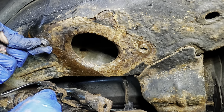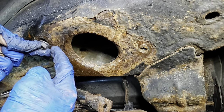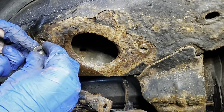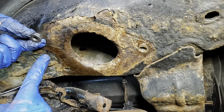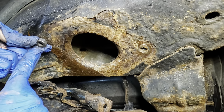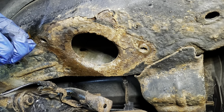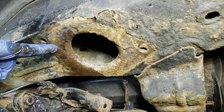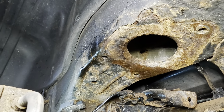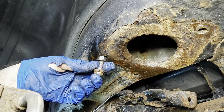So then we're gonna place that nut in position and I'm gonna weld it through the hole from this side, effectively attaching this nut to the top of this frame through that hole. And then I can weld that hole shut while we're there. And then this nut will be in place of the one that's already in position there. So I'm gonna go fetch the drill, we'll drill our pilot hole, and then we'll bust the welder out and get going.